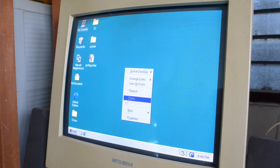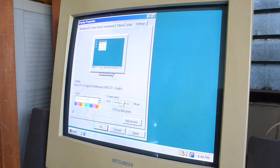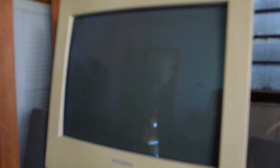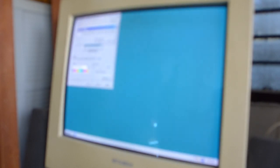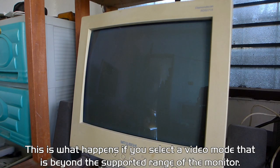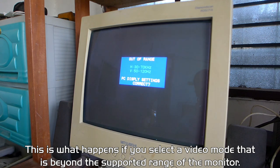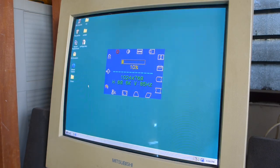The supported frequency range of the horizontal scan rate of a CRT monitor determines the display modes it can support. Most 17-inch CRT monitors in the mid-2000s typically have a maximum of 70kHz, which is enough for up to 1280x1024 at 60Hz or 640x480 at 120Hz. The frequency range required for a display mode depends on the number of vertical lines and the refresh rate of the mode — the horizontal resolution doesn't really factor in much. For example, 640x480 at 60Hz runs at 31.5kHz, while 1024x768 at 85Hz runs at 68.6kHz, which is pretty close to the limit of this class of monitors.